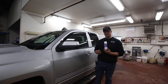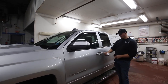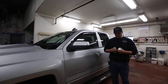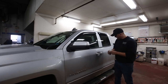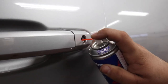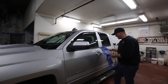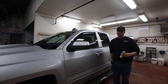The first thing we're going to do is apply the DPL, which is for the door locks. I picked this half-ton because it's got a door lock that is exposed. It's got a little nozzle on the top. We're going to shake it up, stick that through the little flap in the door, and give it a couple of shots of spray until you see a little bit come back out. Just have a rag ready because it can make a mess. Give that a wipe, and that's all you've got to do to keep your door locks from freezing.